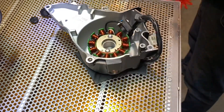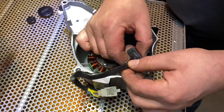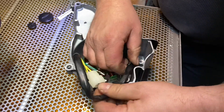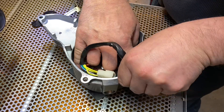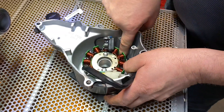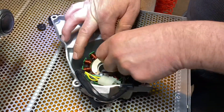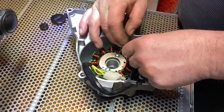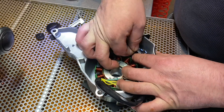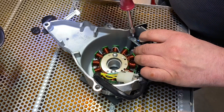Stage two: pull the rubber grommet up out of the way first — it's a little bit tough — then push it down into place roughly where it's going to go, and tweak it afterwards. Make sure you push the little metal tab down so it's away from the flywheel. Then hook the pulse coil in.